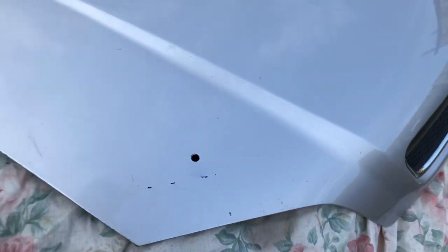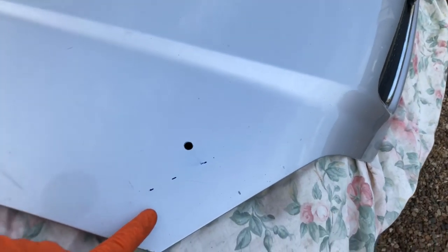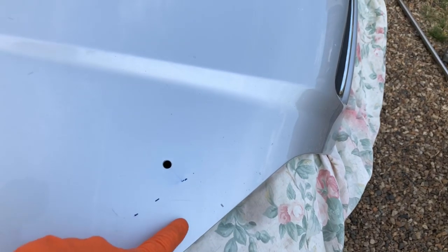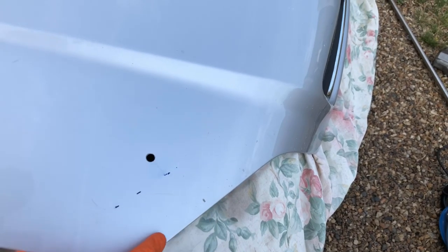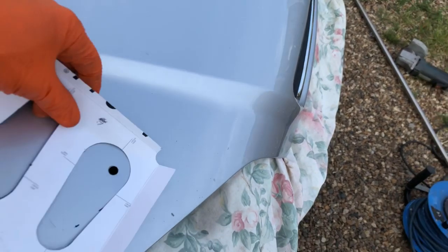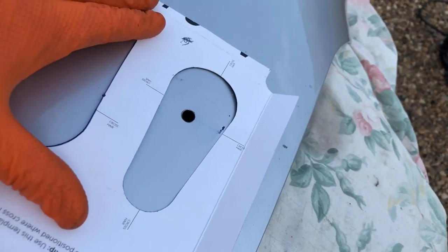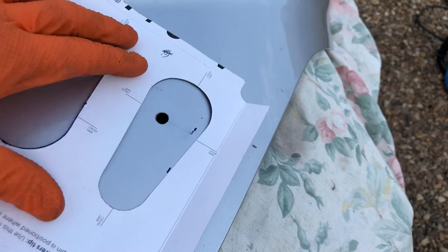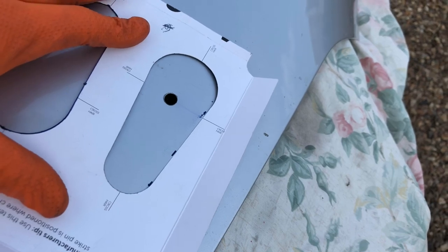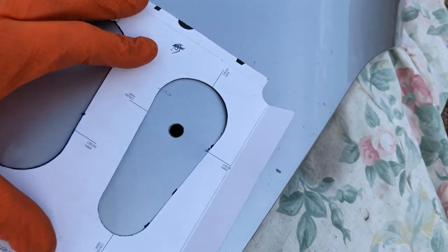You've drilled your hole through the bonnet and this is going to be used for the cross-hatching. I know from previous times of doing these bonnets - loads and loads of times - that these catches come about five centimetres from the edge of the bonnet. So I always measure 50mm away and mark it with a line so I've got some sort of guide. On this template there's a cross-hatching each way, and that's going to centralise this hole and make sure your aero catches fit perfectly.